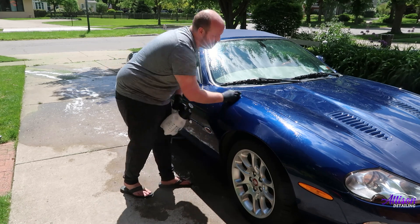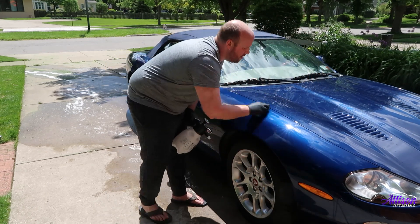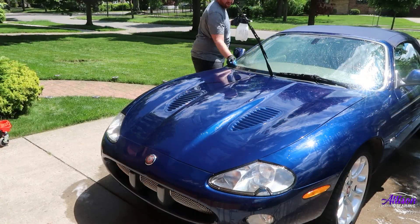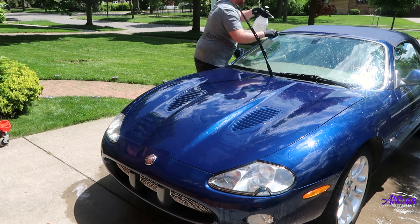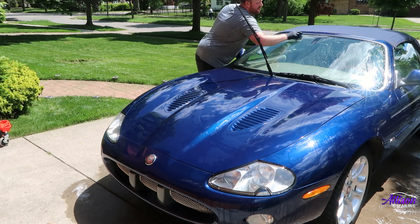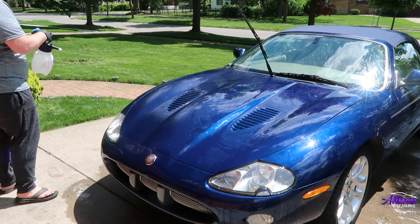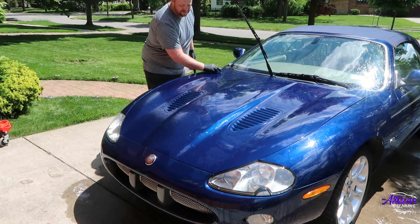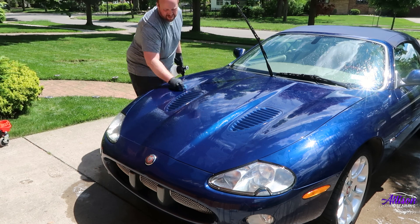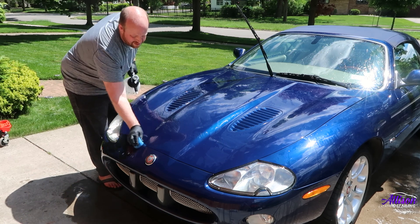There are different types of automotive clay out there, but I prefer to use the NanoSkin Auto Scrub Sponge. I'm also using some Optimum No-Rinse diluted 256 to 1 in my Marilex Pump Sprayer to lubricate the paint surface. For this step, spray the lubricant onto the paint — I also like to spray the sponge as well — and then work in small sections going back and forth over the paint. If you feel any roughness with the clay, keep working the area until it feels smooth. We're going to repeat this process over the entire car to remove as many bonded contaminants as possible before we start polishing.